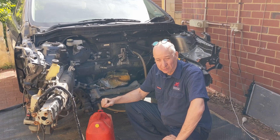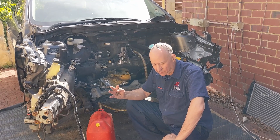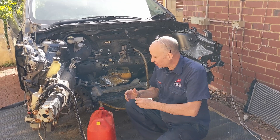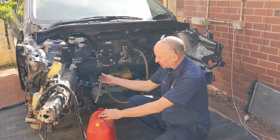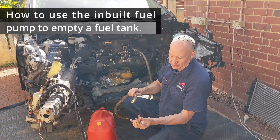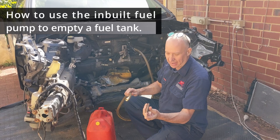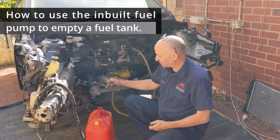One of the things I do before I send the car off for scrap is I remove the fuel. You'll remember from one of my previous videos I used a jiggle hose. Basically a jiggle hose is a standard hose with this little jiggle attachment in it, which is basically a marble — a captured marble. And I used it to create a siphon.